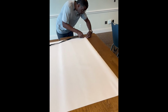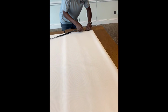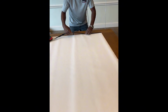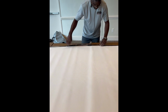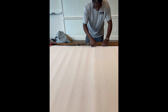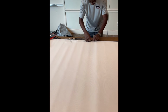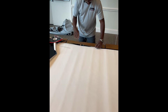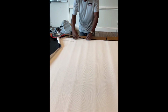All right. So basically, lay it on the corner, on the edge, and without pulling it, all you've got to do is lay it down along the edge just like that. You don't want to put any stress on the tape. You just want to lay it down. You don't want to stretch it. Don't pull it. That way it'll stay down without puckers and give you a nice form and fit. So that's all there is to it. Just go down the edge like that, and I'll pull the backing off as I go so it won't be sticking to everything. So nice and easy. Lay it down.